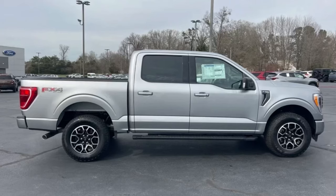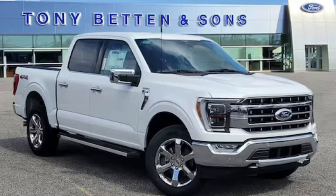Before we talk about the 35s, let's talk about what's tried and true. Your F-150 is going to come with a plus 44 offset wheel and tire package — 18 inch, 17 inch, or 20 inch — which is why they're very narrow in the fender. F-150s come with about a 31.5 to 32 inch tire, and they come with a factory rake so the nose dips down.